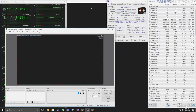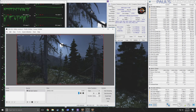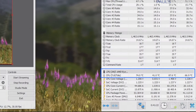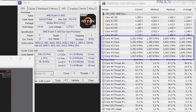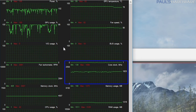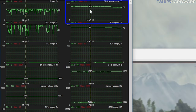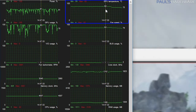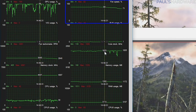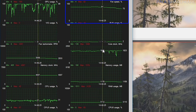In this test I saw a combination of results from the CPU stress test and the gaming test. The CPU was running warm but not terribly warm — it wasn't throttling, running at about 3.4 GHz. The GPU frequency was hitting the same as in the strict gaming tests, and temperatures were about 82 degrees on the GPU. When I pulled off the dust panel on the GPU side, temperatures dropped down to 77 degrees and were still falling.